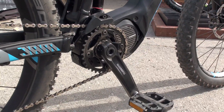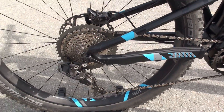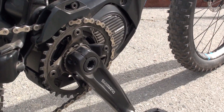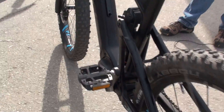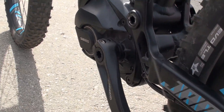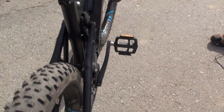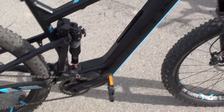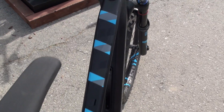It's their first mountain bike specific drive system at the XT level. And I think Shimano's experience as a bike company really shines through in how they designed the drive unit. It's incredibly compact — it allows the drive to stay out of the way of the bike designers when they're designing the geometry of the bikes and the suspension pivot points. The goal with this bike wasn't just to make an electric mountain bike, but to make a great riding mountain bike. Shimano has the exact same Q factor — the distance between the pedals — as on their non-electric XT crankset. If you put our Jam Squared electric assist bike up against the Jam non-electric, the two bikes are almost identical in terms of geometry, so the handling is not compromised at all by the electronic components.